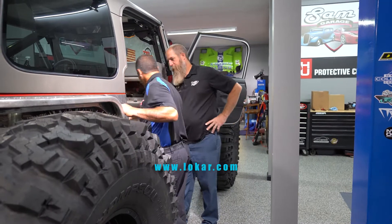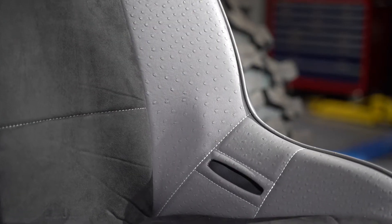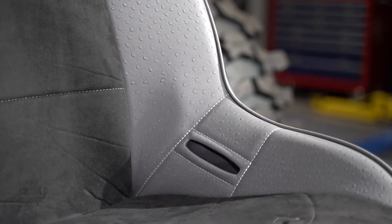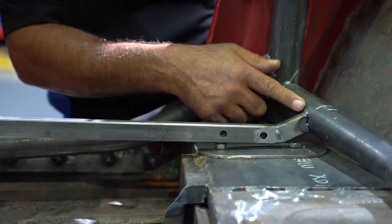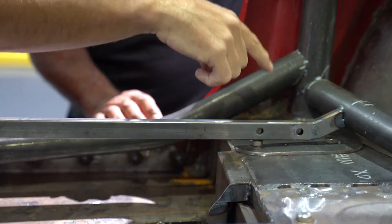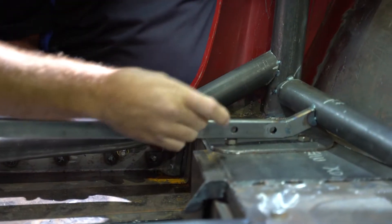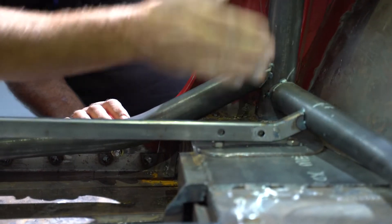We're down to one of the last items today. I love the cage you made for the seats. We needed somewhere to mount, and we really want this attached to the cage because if something really bad happened, we want to be in the cage, not attached to the Jeep floor. That way you can also attach the seat belts to the seat and the cage and be safe and secure — it's kind of like a capsule. Just like in any prototype or mock-up stage, you might run into problems. We ran across an issue where we lined up dead on the bolts for the roll cage, so we'll either jog this or work around it — nothing's set in stone.